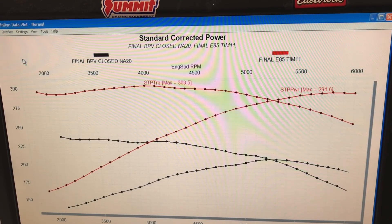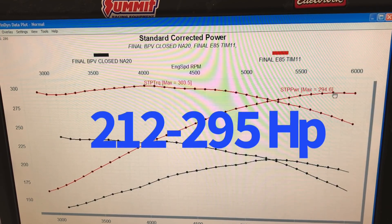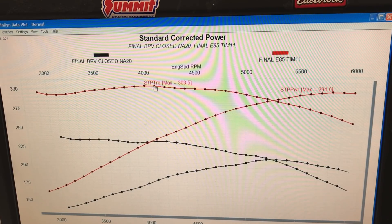Here's the comparison when we were running the supercharger in optimized trim with E85 and extra timing - which allowed us to run more timing under boost. The supercharger took output from 212 horsepower up to 295 horsepower. Peak torque went from 235 foot-pounds up to 303 or 304 foot-pounds. The boost is obviously adding power all the way through the curve. Because we have a rising boost curve, we also see bigger gains on the top end than on the bottom, despite a roots blower being known for immediate boost response. These are the differences running naturally aspirated versus the same motor under boost with the factory M90 blower.